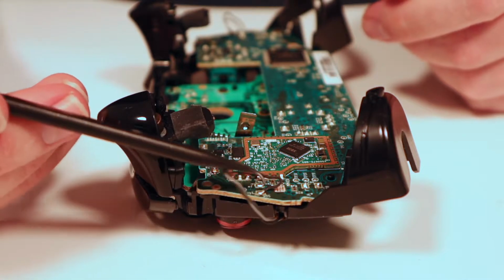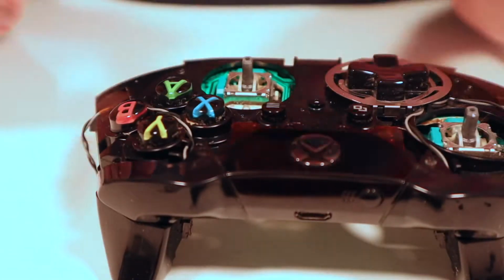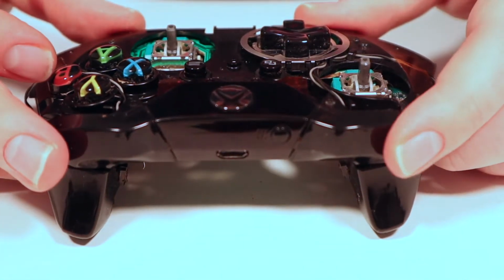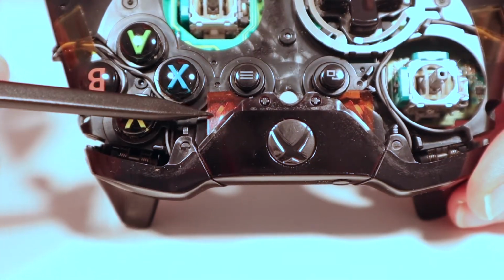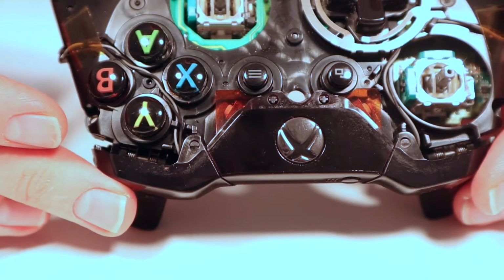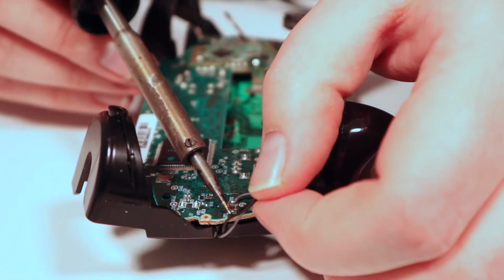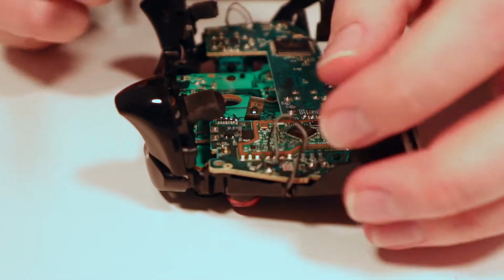So once you've got the rumble motors removed, there are two wires here. There's a black and a grey wire. They go to the little buttons on here, which are for the shoulder switches. You can probably just about see, actually, just about in there is that little button. So this shoulder pad is connected to that little button, so when you press that, you just about see it moving there. That's how the shoulder clickers work. Okay, that one and the grey one.